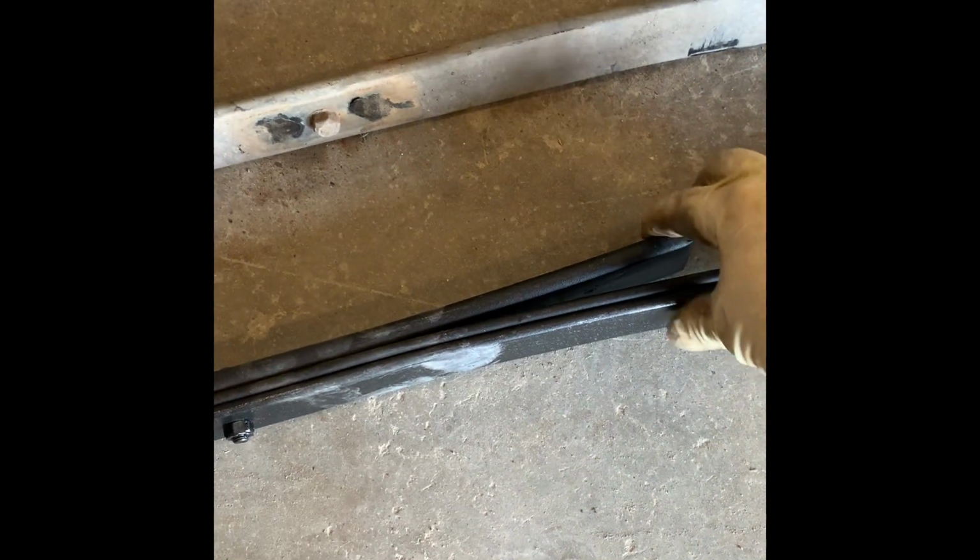So for this lift kit, we're gonna be doing a heavy duty rear leaf, which on the original one you have one leaf. This one's dual action, which means it has two solid, and then the third is only going to come into play whenever this squeezes towards it, and then this heavy duty one will go into play then.